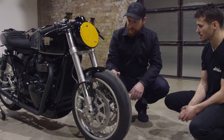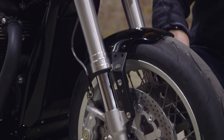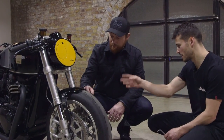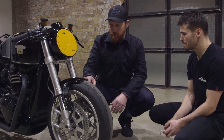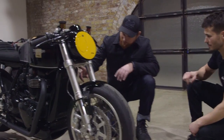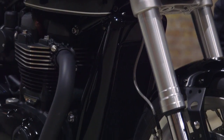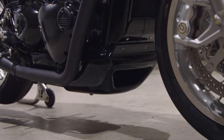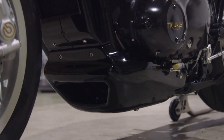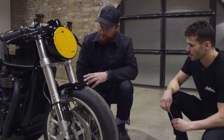The mudguard bracket and mudguard are all handmade — aluminium guard and steel brackets, folded or welded in the workshop, with holes for lightening. It's a hand-rolled, beaten English wheel job. The rad shroud was a real challenge — a lot of work to get it to fit perfectly with perfect gaps, perfect lines, and to marry itself with the belly pan. Using the stock rad and putting time and effort into making a really nice surround for it was a better solution than doing a custom rad.